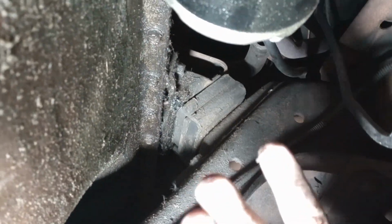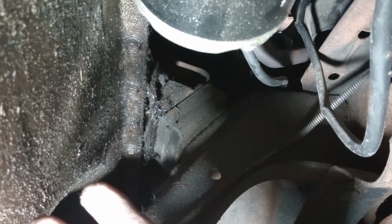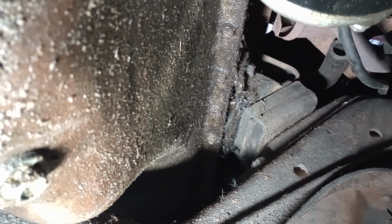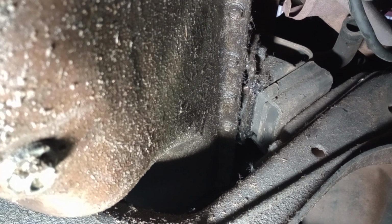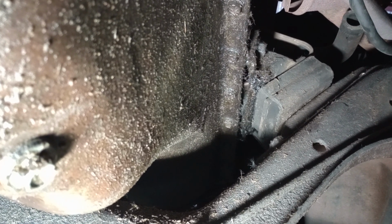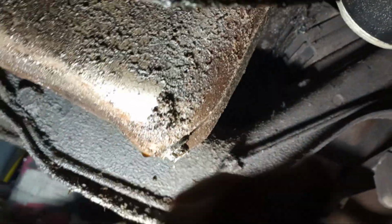And like I said, the front passenger fender is caved in. It's crunched in. There's certain things I cannot get to without actually starting to disassemble the body panels on this truck. But underneath that smog pump should be a junction valve or a junction diversion valve, one of which runs to the whatchamahickey up there just below the carburetor. But both should ultimately wind up going also between the charcoal box and then all the way back here to the catalytic converter, so that unburned fuel gets burned anyway.